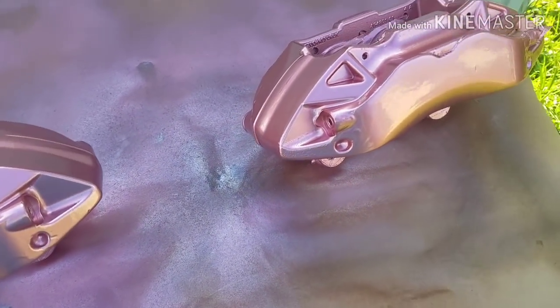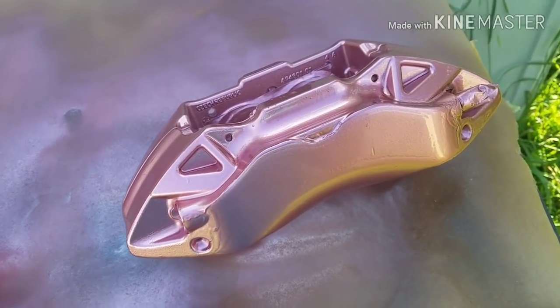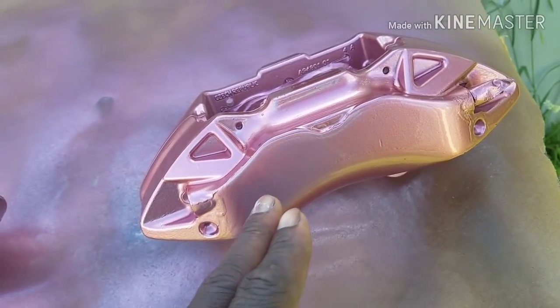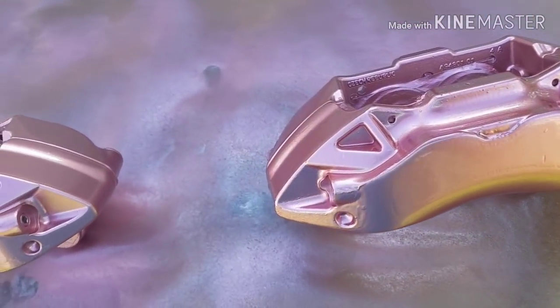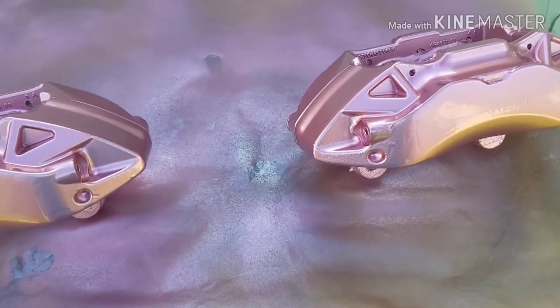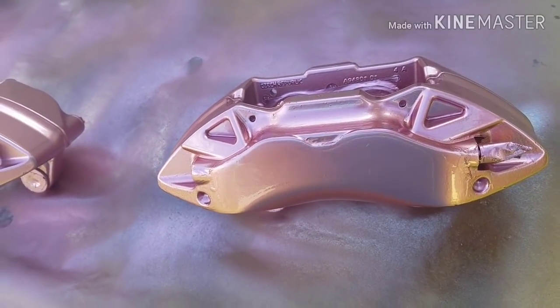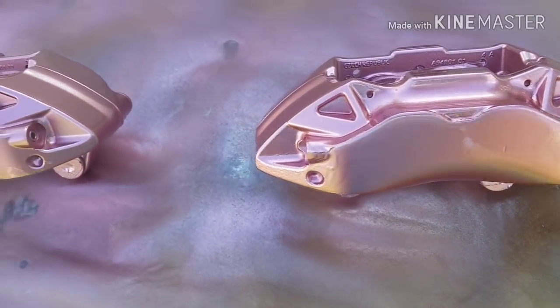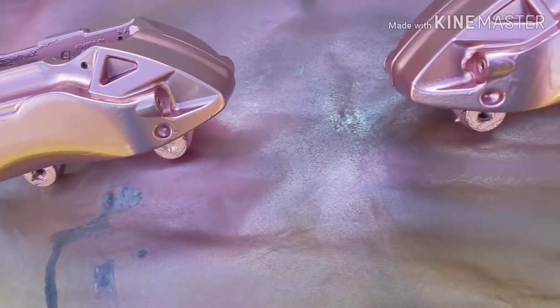Metallic. Had a little reaction right there too, man. So I didn't do these how I usually do them. I should have put on the epoxy primer first, then I should have put on my sealer, because I had a couple low spots when I sanded the Corvette words off. I should have hit it with my sealer, then my paint, but that was just going to linger on the process. When you hit it with the epoxy primer, you gotta wait 24 hours for your top coat, so that'd have been the next day. Seal it, paint it. I mean, I didn't think I was gonna have problems, but that's why I seal them.